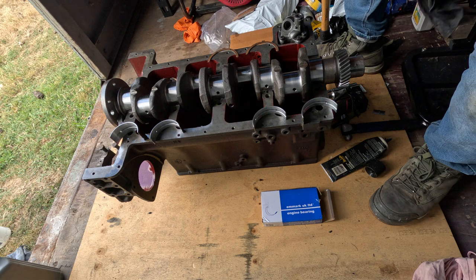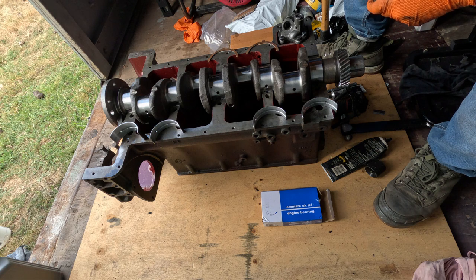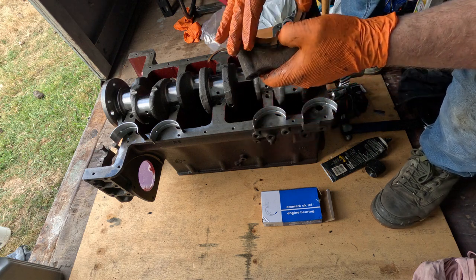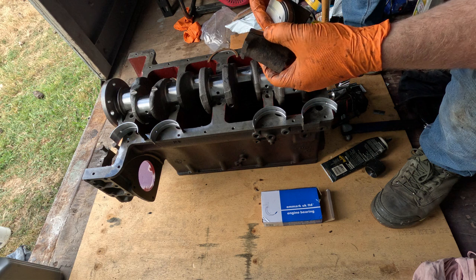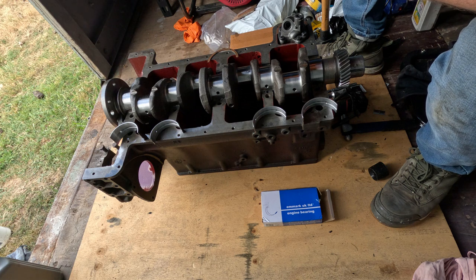Make sure those are nice and clean. So the bearing fits nicely in there. And now if you look at this, you can see there's a notch for our thrust washers, so that'll drop into there, and that'll stop the whole thing from spinning around on us. So we'll add some lubrication to this. I won't check this one, I'll check one of the easier ones to check.